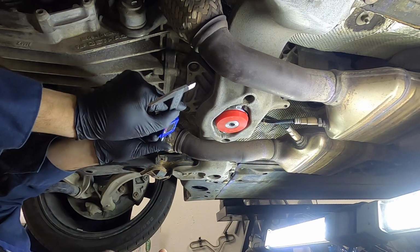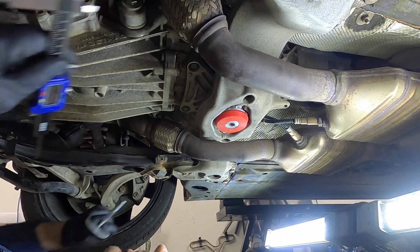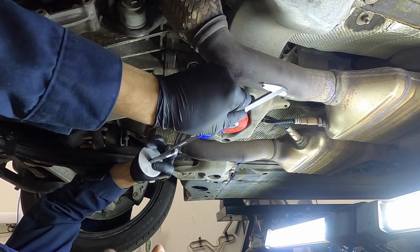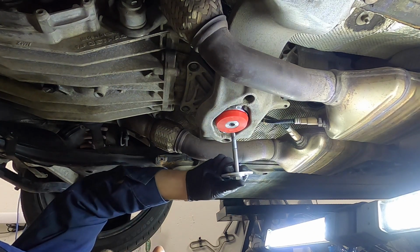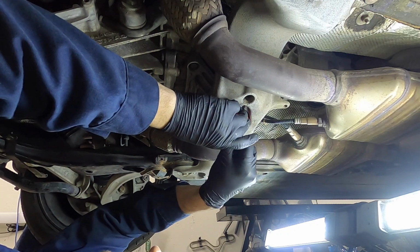And it looks as though we have 85 millimeters of possible space before we make contact. And based on the hardware, I'm only actually using 78, 79 millimeters. So there's about 6 millimeters of grace on here. So it is safe to do this, and I would recommend that you guys do it too.